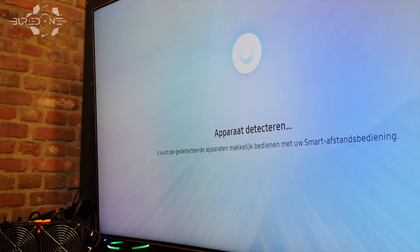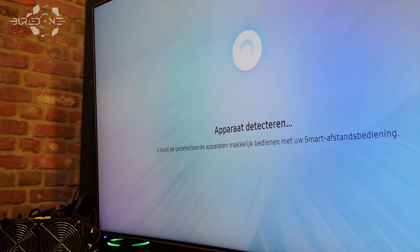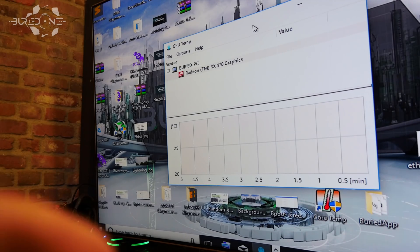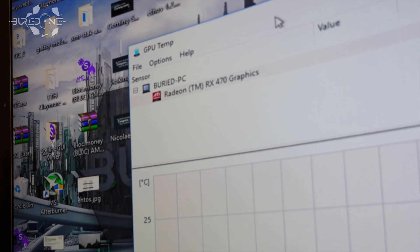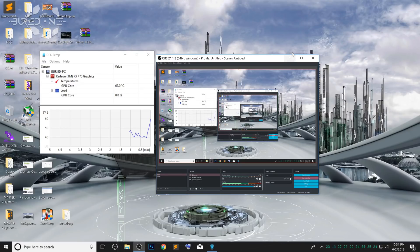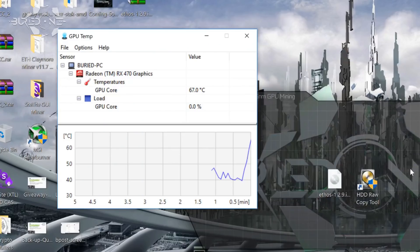Okay, let's get this thing rolling. It recognizes it — that's a good sign. The RX 470 graphics card — okay, so the GPU reached temperatures of over 70 degrees Celsius while not even under load. So we had a problem. These fans were so heavy that they were pulling off the heatsink from the GPU's core, so we needed to figure out another way to cool this GPU, and I came up with another idea.